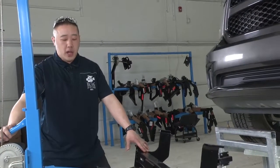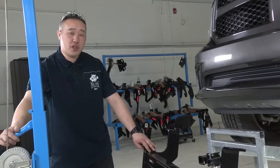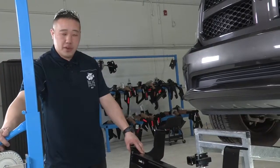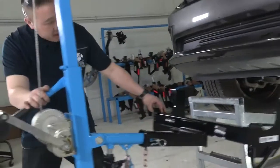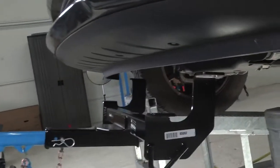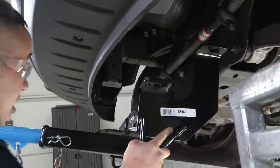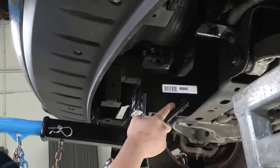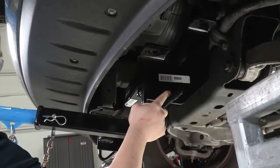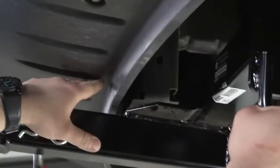We've got the hitch on our U-Haul exclusive hitch mounting rack. If you don't have one of these at home, you'll probably have to get a second pair of hands to help you. The hitches are heavy, so you do want to be safe. We'll be sliding this in towards the vehicle and getting it lined up. What we'll want to do is just get this into position so we can find our notch points, because we will have to trim the front bumper here just slightly to get the hitch to fit into place.